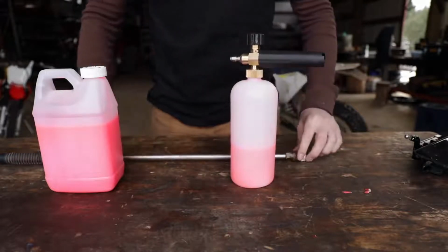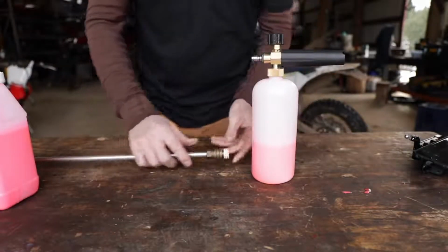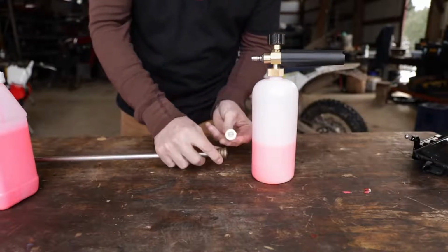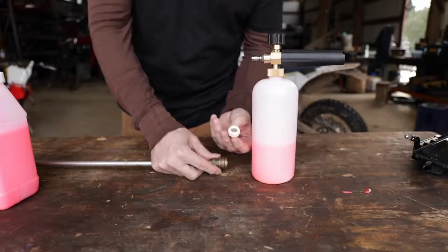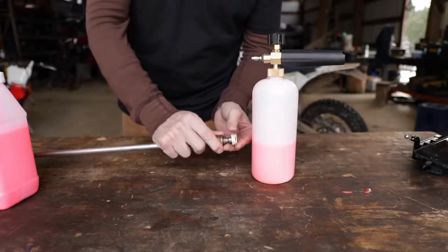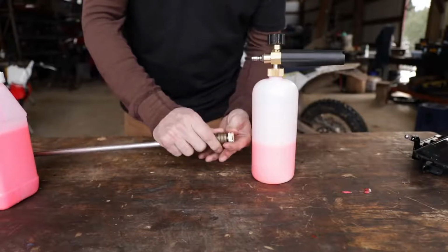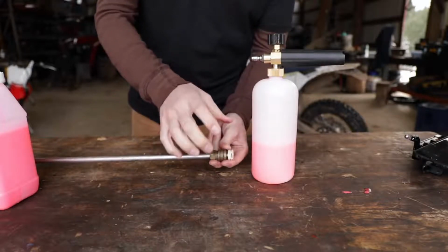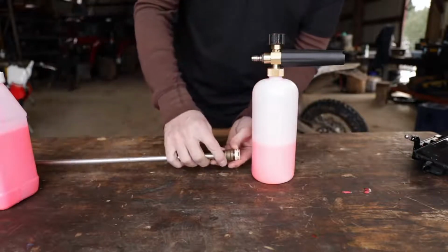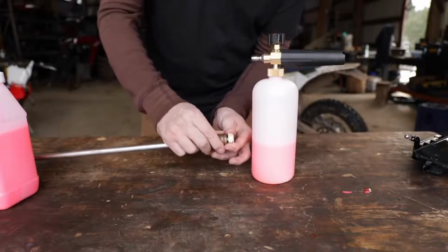And it's designed to fit on the end of your pressure washer wand. Most pressure washer wands that I've seen have a quick attach deal where they have different sorts of spray patterns, and they're kind of universally recognized. The white is a really wide fan, and then you have your red, green, and yellow, for more pinpointed pressure. Washing ATVs and bikes and cars, I go with a white one because I don't want to inject crazy pressure into bearing surfaces and seals. So hold it back a little bit and use the white one, and usually you're pretty well off.